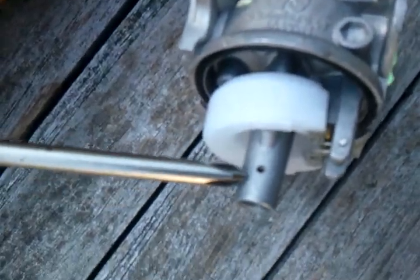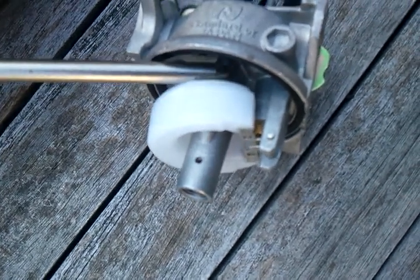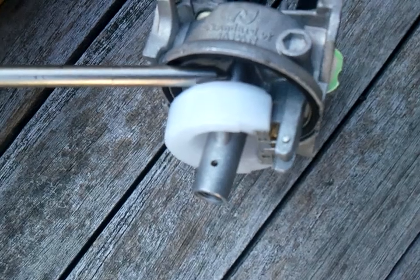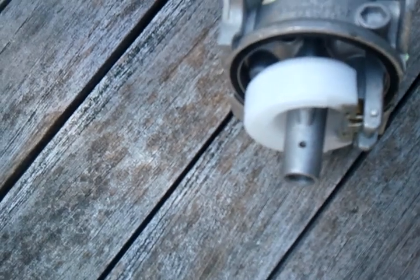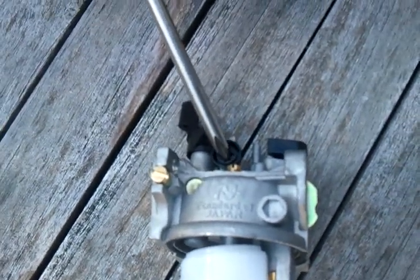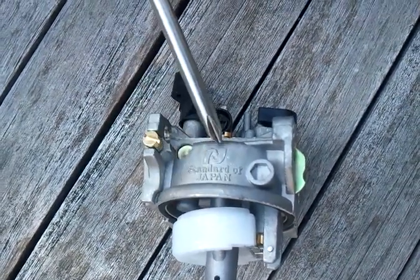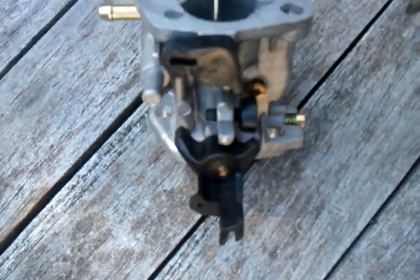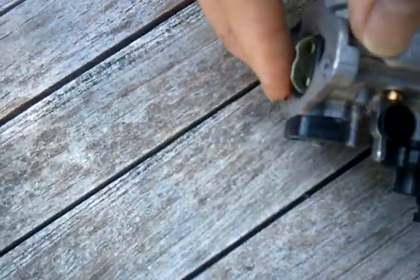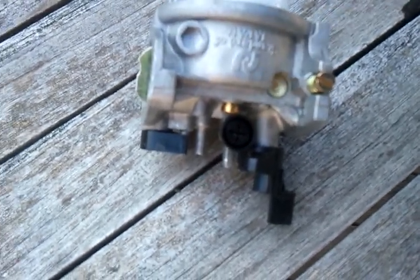But this is your main suction tube here. This port right here — you can actually follow it up, there's a line — that's where fuel is getting sucked up into this idle control jet. Make sure that that whole section of line is clear, but more than likely this jet has an ultra-fine, ultra-small hole in it, and that jet's what's going to cause you the most trouble. That jet is going to be the focal point of your idle control problems.